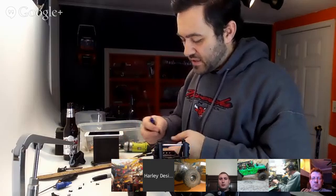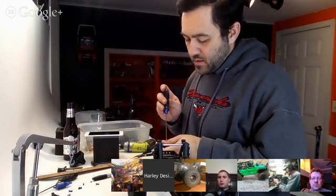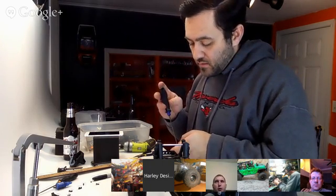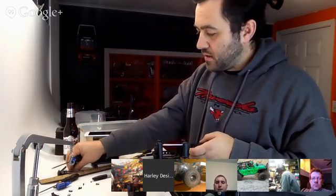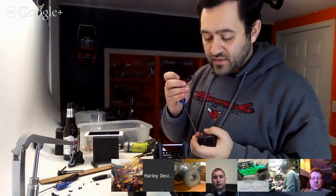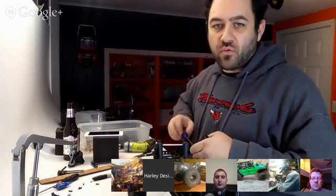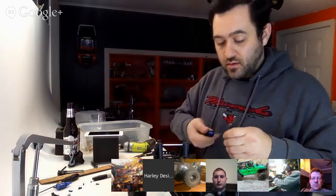Gotcha. Now, did you lift the rears as well? I only lifted the rears. Okay. The front is 3-linked. Oh, that's right, because you're Panhard. Right. Now, since I didn't do the Panhard, would it be a benefit to lift the fronts as well if it's still 4-link? It very well could be. You'll kind of have to, lifting it a little bit should definitely help. You can play around with how much. And it's also less than half the weight of the stock chassis. For me, when I'm looking to compete with it, I'm trying to keep the center of gravity low, so reducing half the weight of one of the highest things in the truck now, which is the chassis, because everything else is starting to sit lower and lower.